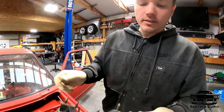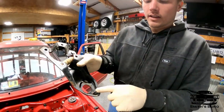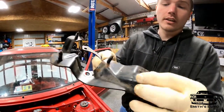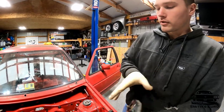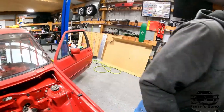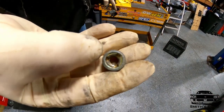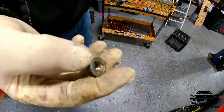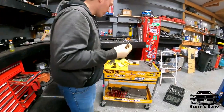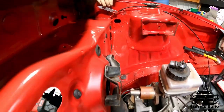The brake booster bracket is different from a Mark III — a Mark III would have the studs facing inward, but this one has them facing outward, and it also has this extra stud bolt right here. Make sure these all fit and then go inside the car and put on these really crazy-looking self-locking nuts. You can see they have these tangs on them — they're self-locking and only to be used for brake pedals and things you don't want coming off. Now you bolt it in.